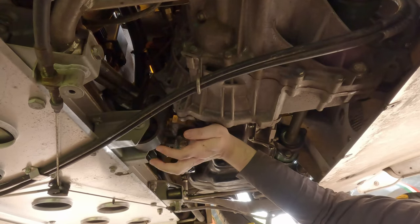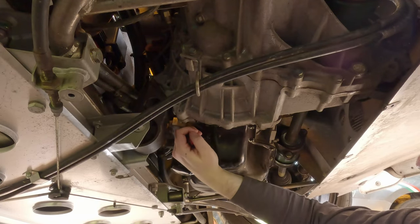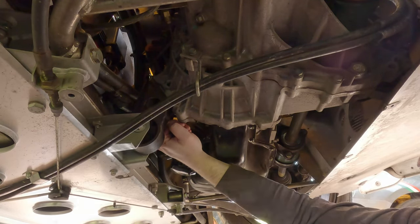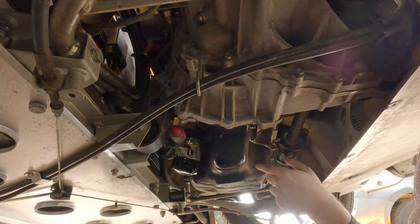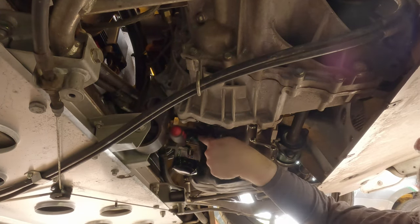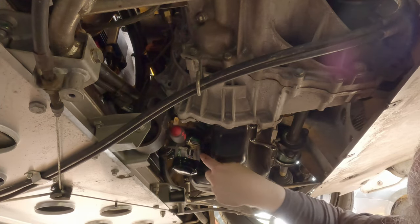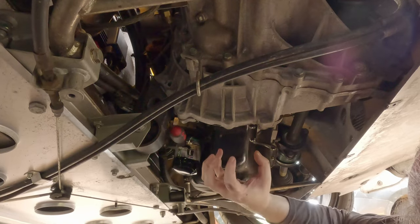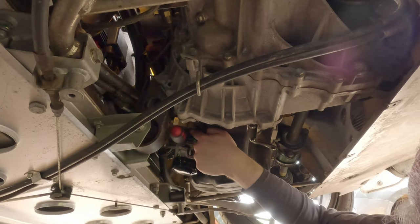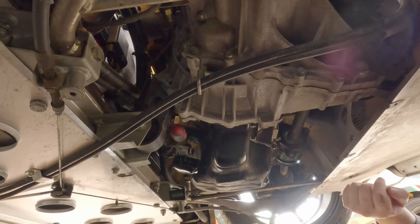All right, take two on this. This is crazy. I have never seen an oil filter stuck on like this before. Maybe I can get a chisel right up on the edge of it to try to knock it loose. Down here, it's just sheet metal, right? Yeah. But up at the top of the filter, it's actually solid. So maybe if I can drive it in there and then hammer in the direction that it unscrews.